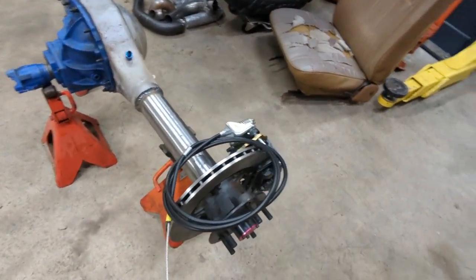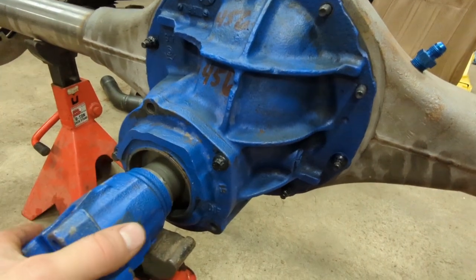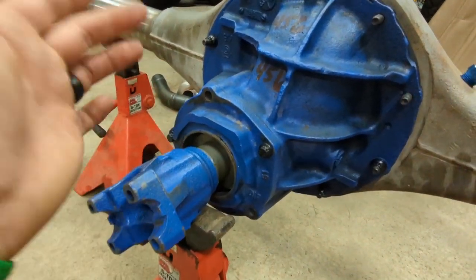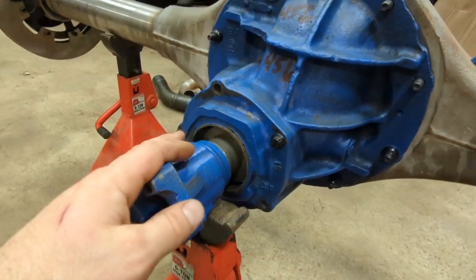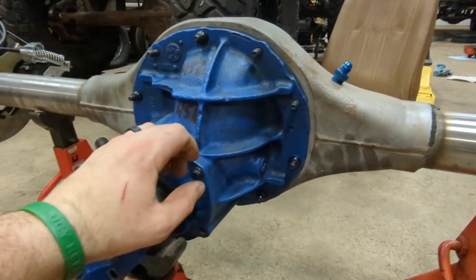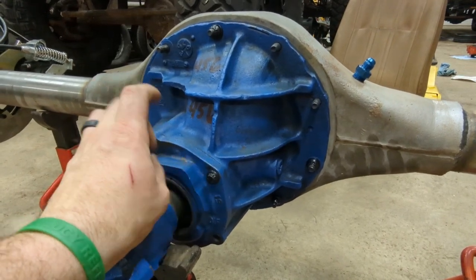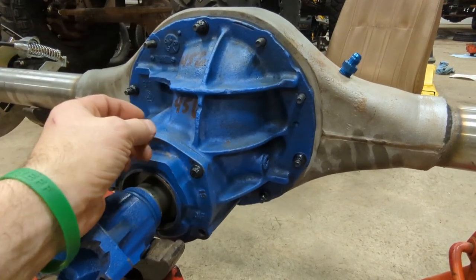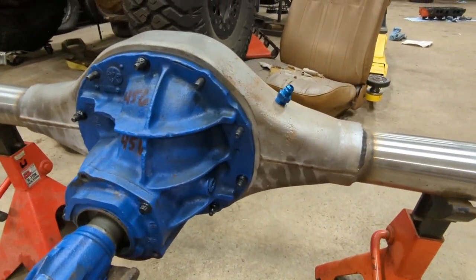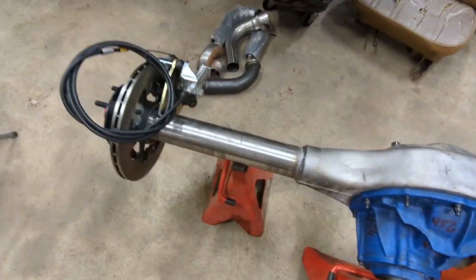In a nutshell, that's how you build a Grand National 9-inch. Now, obviously it's not totally done — I still need to take the center section back out, take the pinion housing back out, get the correct pinion preload on it, get the pinion seal in, reinstall our yoke. Then at that point we'll get our caps tightened up, get our backlash adjusted accordingly, do our marking on the teeth — which I'll walk through in the next video — to make sure our pinion depth and backlash are looking good. Then we'll get this thing in the truck, get the old 10-bolt removed out of the S10, and get the leaf springs removed.